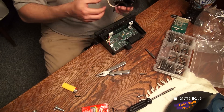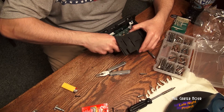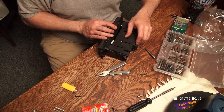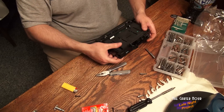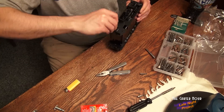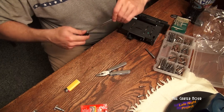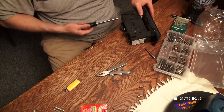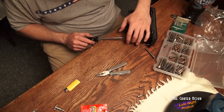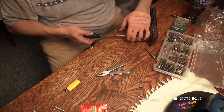I'm going to go ahead and reassemble this piece back in. When you're reassembling, you plug this lead back into the surface and put the circuit board down. We are plugged in. I'm going to slide this in — there are two tabs up in the top here. When you slide this back in, you're going to slide those tabs in and then it should just fall back in place. I'll take our Torx bit screws and reapply them.